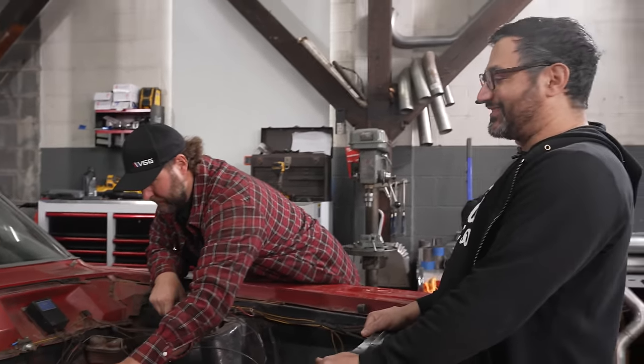So this guy here, if you press a button, it locks this valve in. So you pump up the brakes, hold the button, and this basically holds the front brakes in position to where you can let off the brake pedal and your front's going to be locked. Your rear is free, so you would use this to do a burnout or heat the tires up, basically, or just street driving fun.